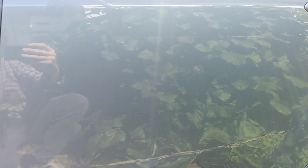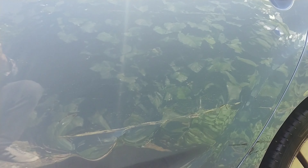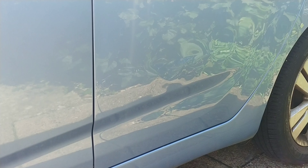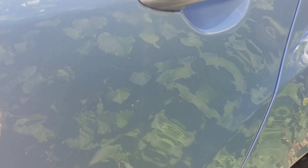I'll keep checking it and spritzing the pad with a pad lube as well, making sure there's not too much heat getting into it. We don't want to cause any more damage to the rest of the panels — that would be absolutely tragic. Let's get cracking with the equipment and begin with these lighter marks here and see where we get to. There are even some abrasions into the front door as well. I'm really pleased with that — it is not perfect but it is a hell of a lot better than it was.